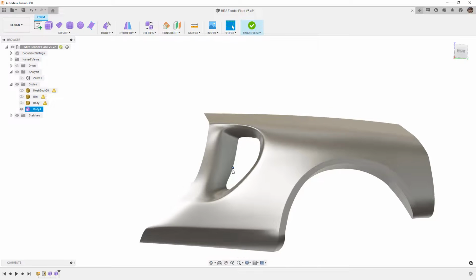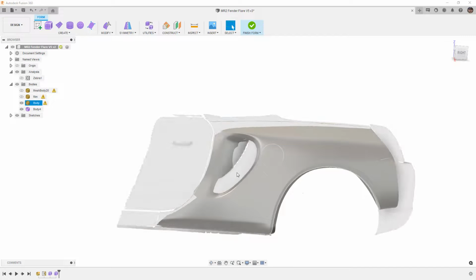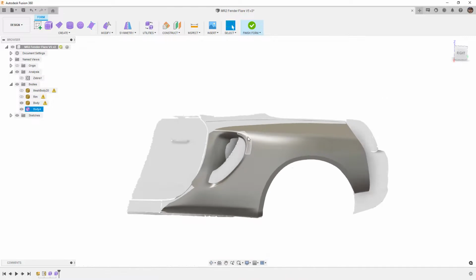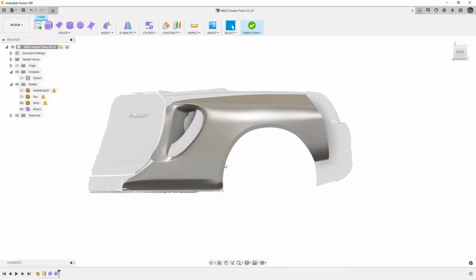Remember, if we're making an entire fender or if we're cutting away most of the fender underneath, we don't have to worry so much about the stock transition because we're only going to leave probably 2 inches of the fender at the front. So we really just need to make sure that we transition well from the door, and then we can cut away all the rest of the stuff on the inside. Obviously, we need to add more control. It's going to be a common theme.